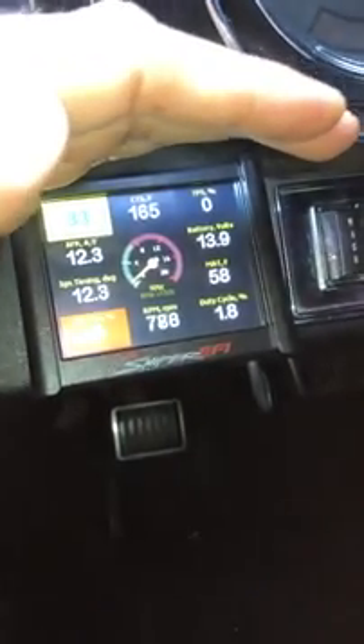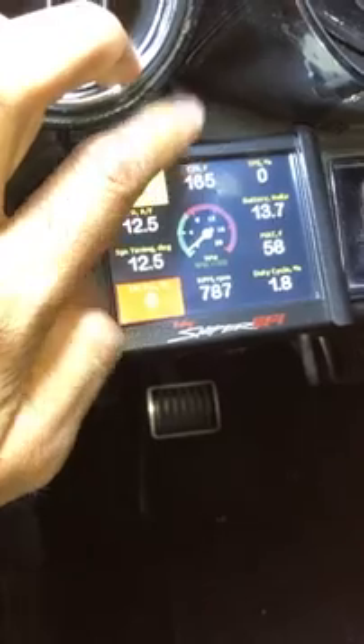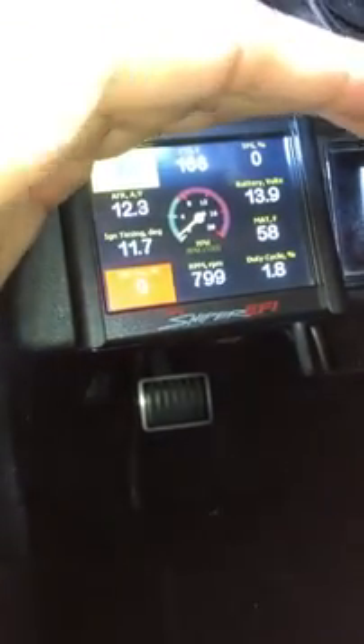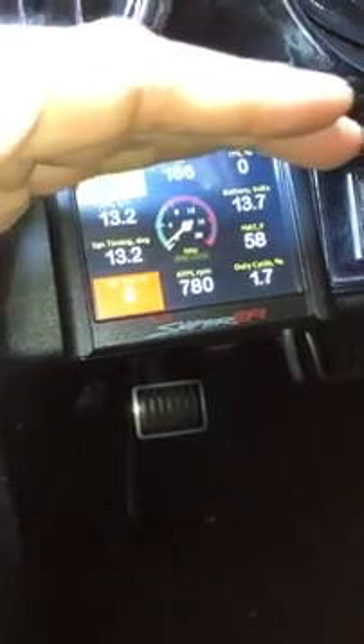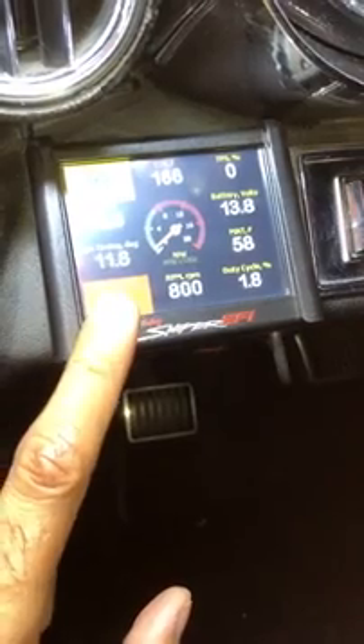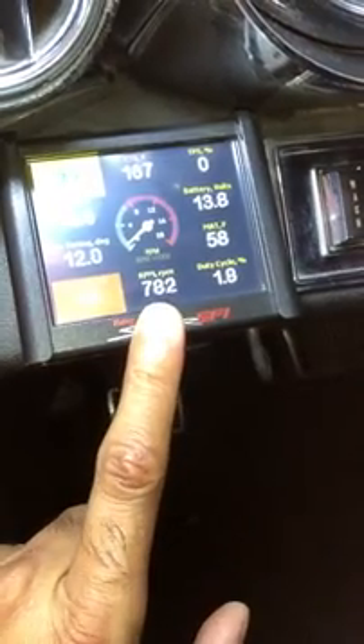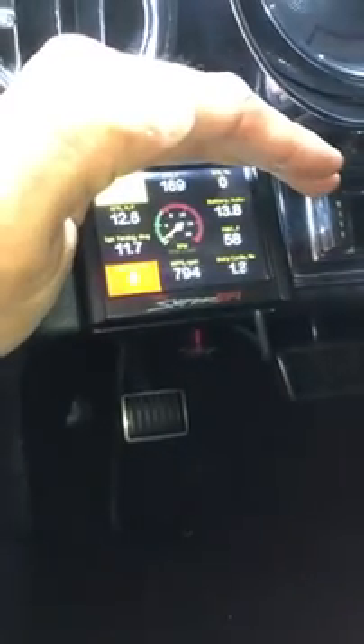To make things worse, when my engine's actually hot and I'm driving the car — or parked actually — this IAC out of nowhere will start jumping up to 90, 80, 70, 100% out of nowhere. That raises my RPMs to anywhere between 1100, 1200, all the way to 2000. You can just imagine how hard it is to keep this thing stopped at a stoplight with the brake pedal when your motor's idling at 2,000 RPM for no reason.